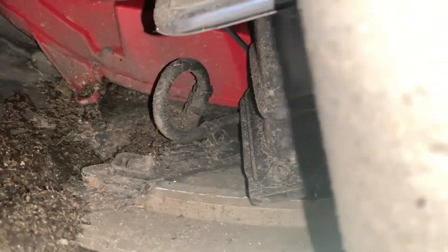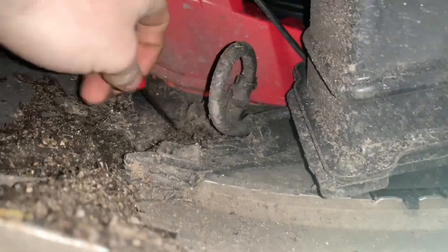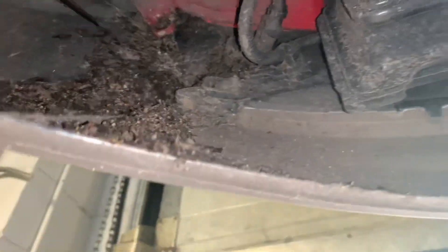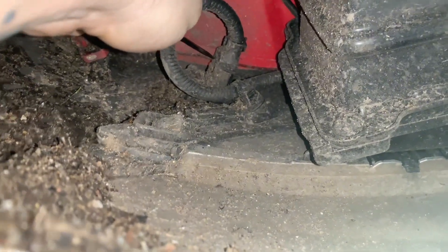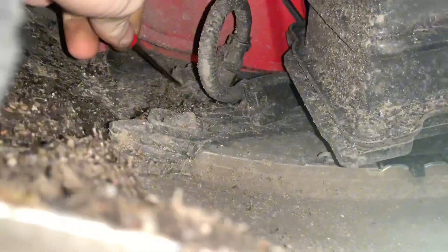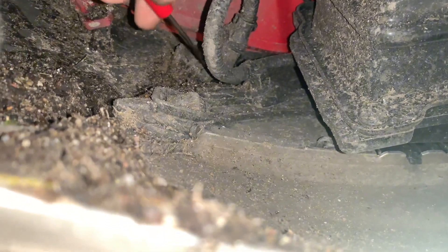Next to the exhaust, just up here — that is the wire and that's our parking sensor. It's going to be a lot of fun coming down in my face! To unplug it, there's a little tab just here — push that in and pull it off. Then either side of the sensor we have a tab here and here, which we need to spread outwards.